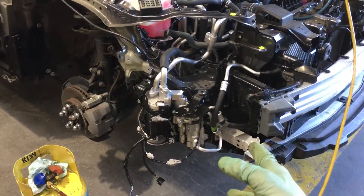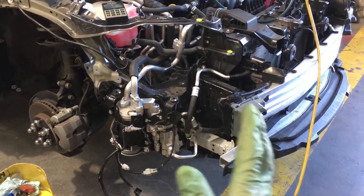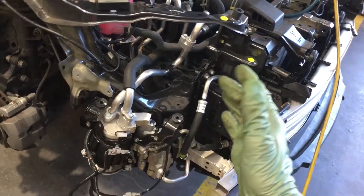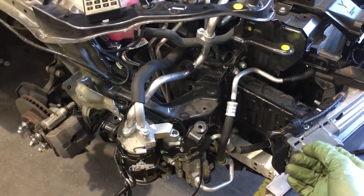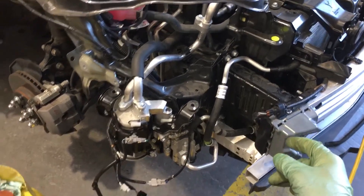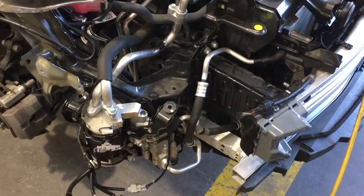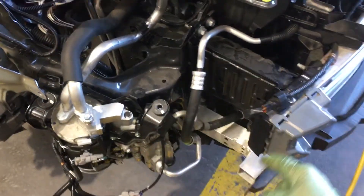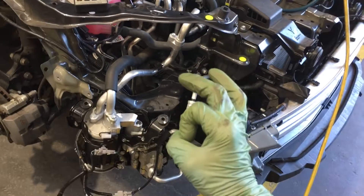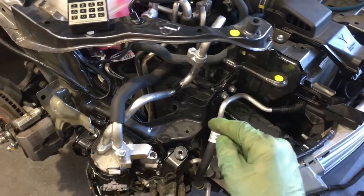So I will immediately fill this up after doing the recovery — fill it back up with nitrogen to displace any possible air coming in. I'll put it at positive pressure, two or three PSI. And I took the technician working on this vehicle and explicitly explained to him to go get some rubber plugs and caps, and as soon as he takes apart every component, to thoroughly put in plugs on all the vacuum ports and cap off all the lines.